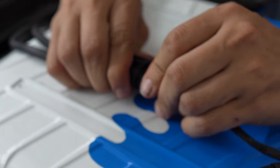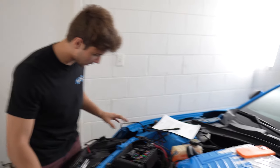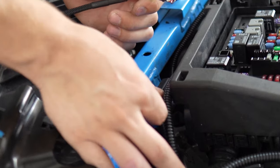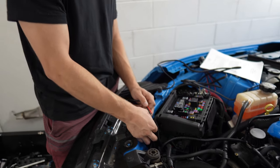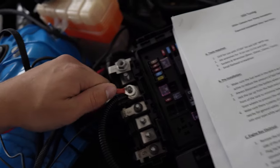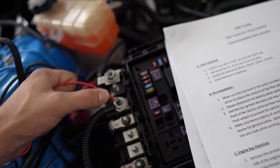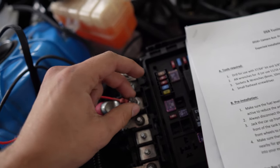Now we're going to route the wire from the back of that sensor to the fuse box. This is your fuse box here. You have a factory ground located on the apron near your radiator, and we're going to put the eyelet on this side. We take the unpinned wire as instructed and go on top of the power — that's just the red one that comes into the fuse box. We also tap this for the Whipple harness.